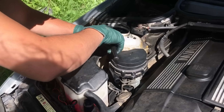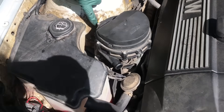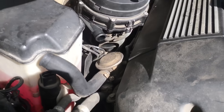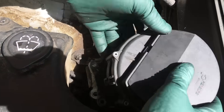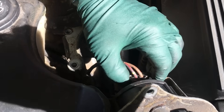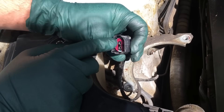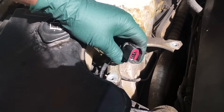There are only three 10mm bolts around the pump — one here, one there, and one back here. All you need for this job is a flat-headed screwdriver and a 10mm with probably an extension because it's kind of deep. There we have the connector. It's a push-tab pin — you push the pin and then pull out. There are two pins you push and then pull out.